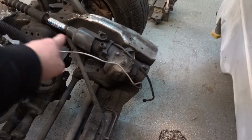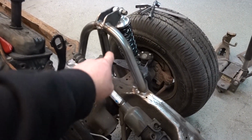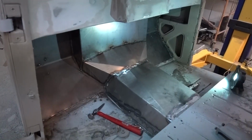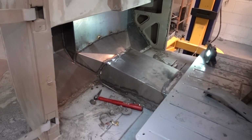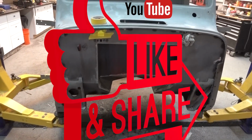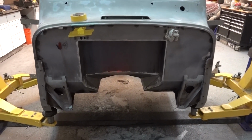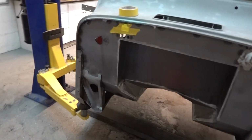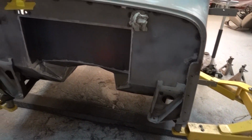And then of course we have the power steering. That's going to be underneath the front bumper. And again, second shock tower. And they did get the majority of the transmission tunnel in, along with the firewall. Now, isn't that clean? We had to go into the cab 4 inches to make room for the V8 that's going in here. But just really nice, slick, clean, great look.